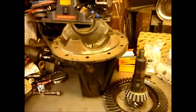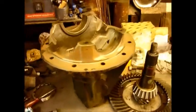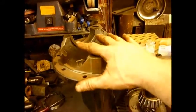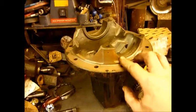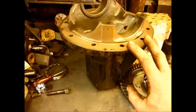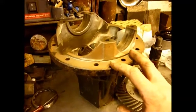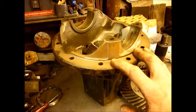We start off with a casing - this casing is going to look a little bit different by the time it starts getting built. We obviously take casings in, put them in our jig - the jig tells us whether these towers have flexed or whether it's still actually in position. These towers actually bend when diffs explode; there's quite a lot of force even when a two-pin lets go. So these cases are first checked for alignment. If they pass that test they go off to a cleaning company who put them through an industrial cleaning tank that takes most of the oil and sludge away, and then through a blasting process.